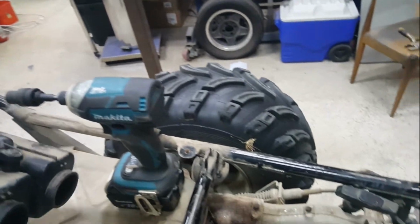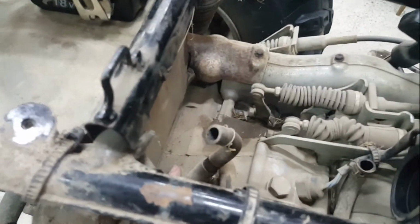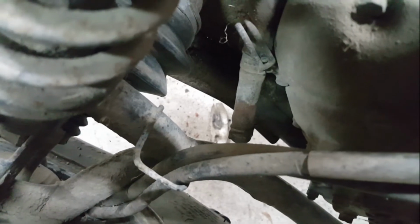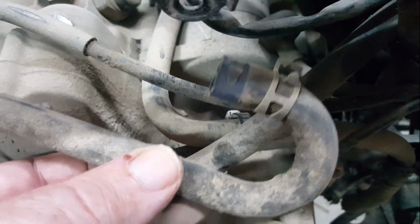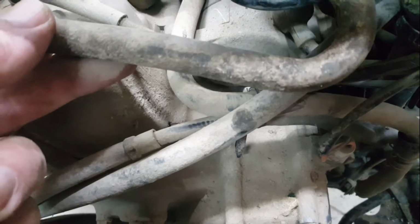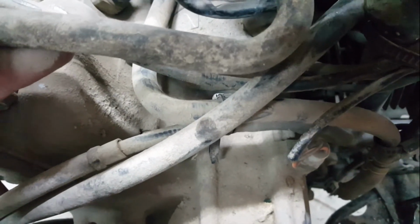So those drains, that's the one for the snorkel compartment. It comes down the side of the motor, and down the bottom there's a cap that can be removed. This one is actually a crankcase breather, it appears. Goes into the top of the crankcase there and comes across there. So this one would suck crankcase fumes into the airbox.